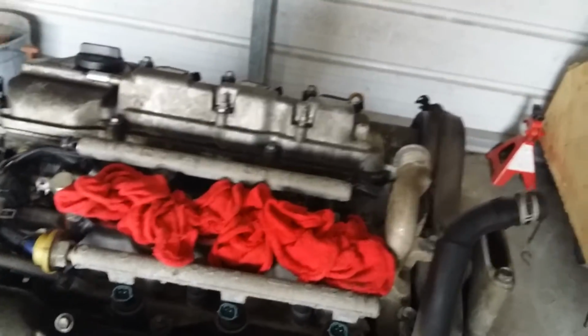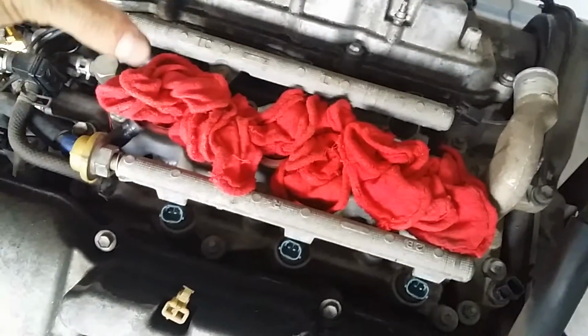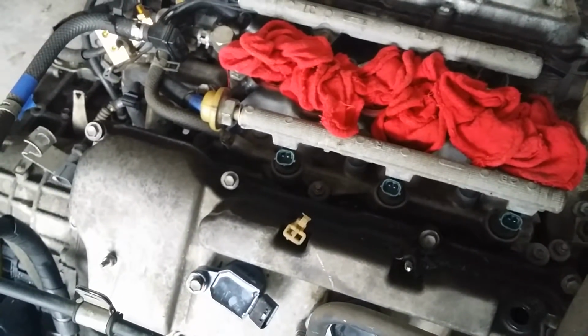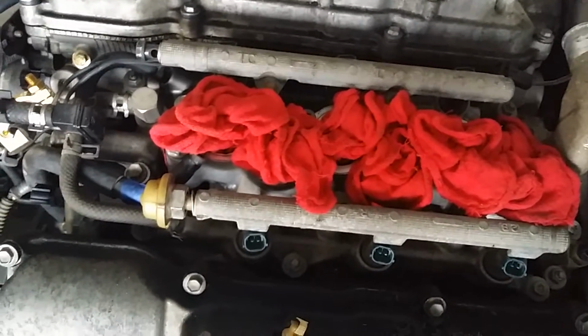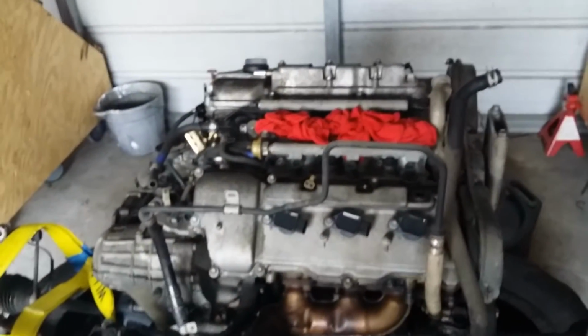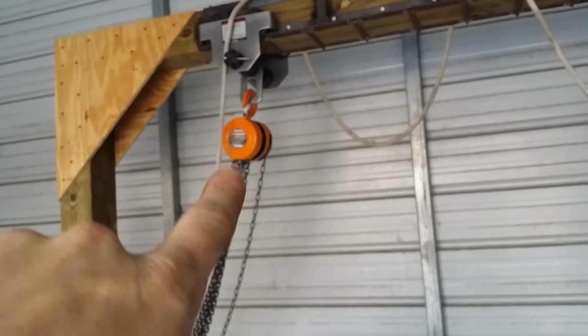So we're gonna go from here, carry the corner to the front over there, lift from a central location. I heard that they have engine block lift plates, and basically you take all this out of here and you put the lift plate in and bolt it down with these manifold bolts. But I don't know. If you get the wrong size, or they say they're universal, but for some reason they don't fit this engine, then I'm out $15. Gotta go back to the store, waste more time. I don't have time to waste. So I figured if I get a chain and some bolts, I'll have the chain forever. It's good to go. I got a rated to 4,000 some odd pound, grade 72 chain. So I won't ever be lifting anything that heavy. I think it's 4,000 some pounds, might be 3,900. I don't know. I should probably check next time I go to the hardware store. So yeah, that's what I'm working on.